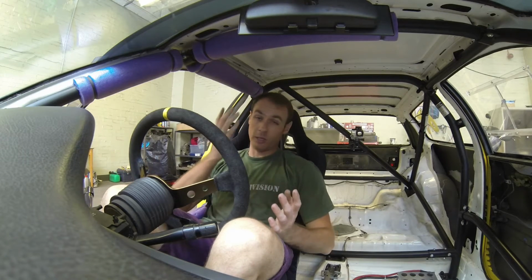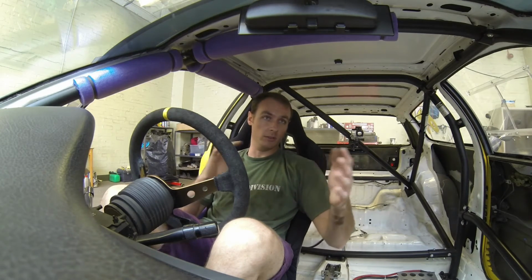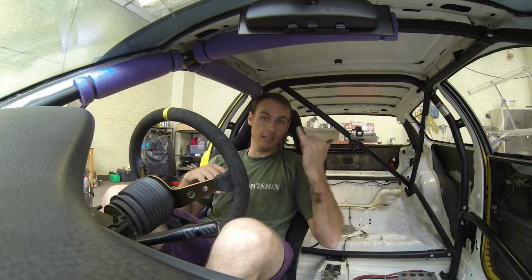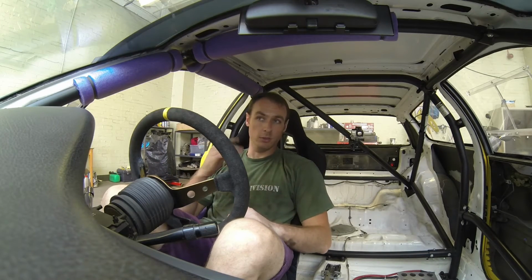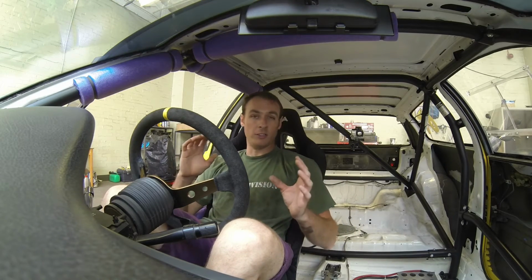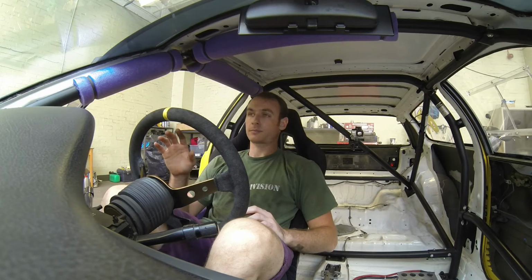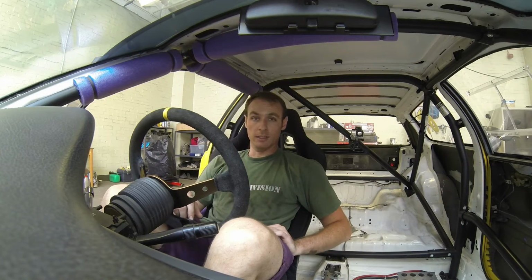If this will help you at all, I found that raising the coilover one turn on each corner, be it up or down, obviously correctly, for example doing the front left and rear right one turn up, and then the front right and rear left one turn down, equated to about 1% of the cross weight difference. That helps a lot, just knowing that sort of basic sum. I ended up finally fine-tuning it just by tweaking the front corner, because there was a lot of weight and I just wanted to push it off of that corner a bit. So I lowered that a touch, and that brought me on to the bang on 50% cross weight. So it worked out all right in the end.